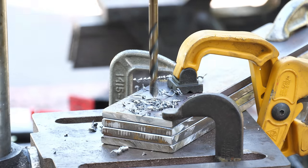With the pipes cut to length, we'll drill a hole for the O2 sensor and size it up until we have just the right fit. We'll prep the surrounding area with a flap disc, get the bung in place, and weld it all the way around. That's the O2 sensor bung all welded up and ready to reinstall.